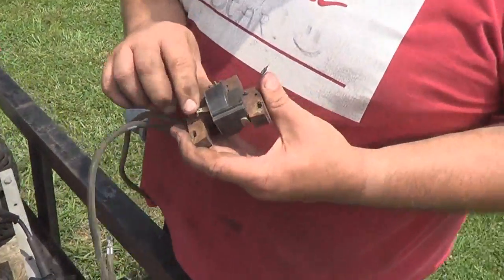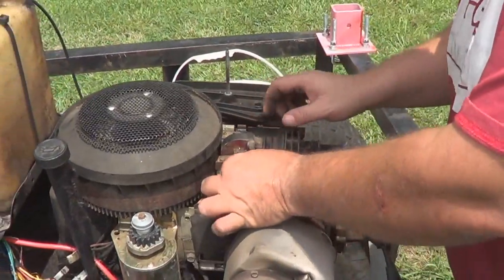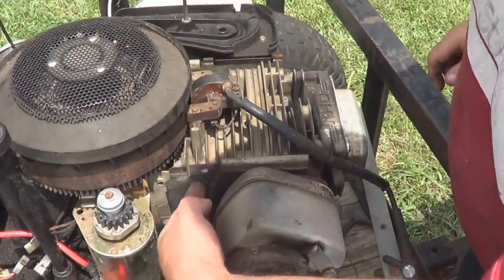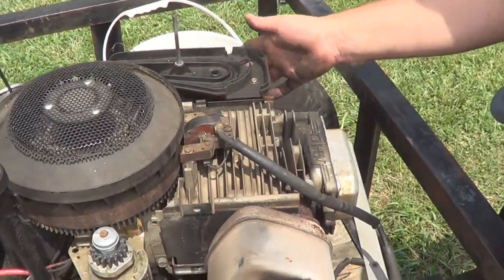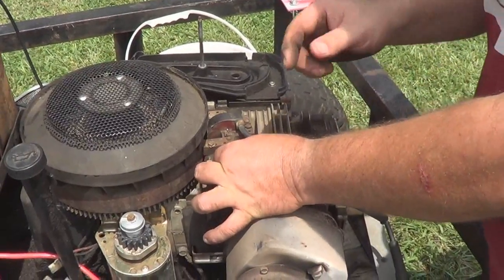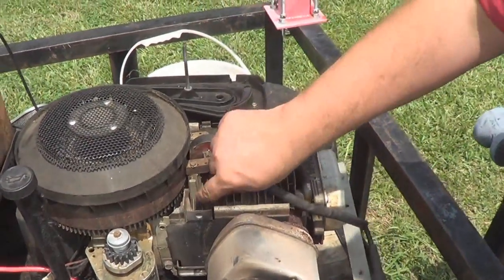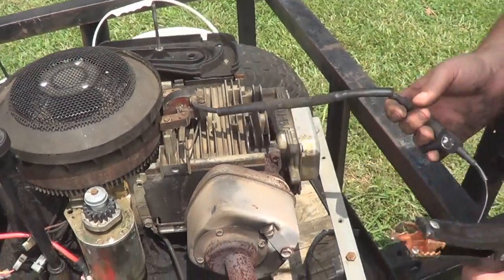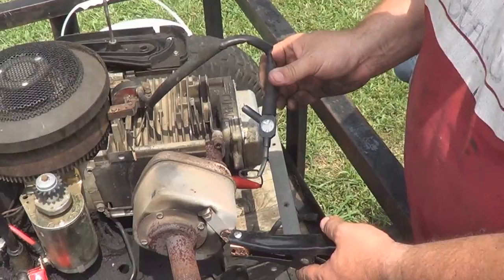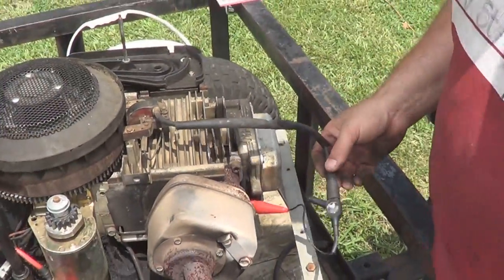All of them have a wire plug under here, which is your kill wire — it grounds the coil out. You do not put any voltage to that; it's a ground only. If you can't get to this, sometimes your plug wire runs out to your motor and you just un-snap it. This one hooks up into the wire with your solenoid over here for your carburetor. It's already unplugged. It runs up under the flywheel — make sure it ain't shorting out under there. I'm going to just unplug it so it can't ground it out. With that kill wire unplugged, if it still won't spark, you know the coil's bad.